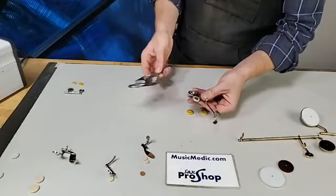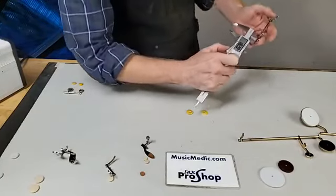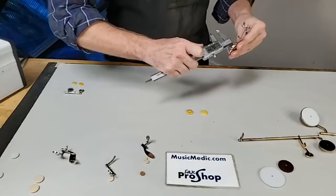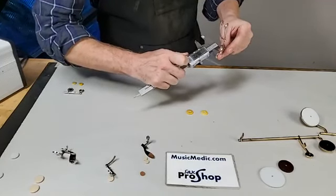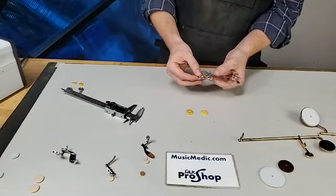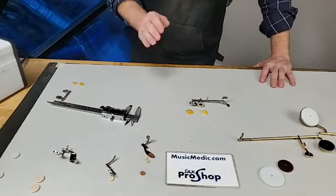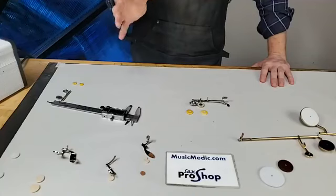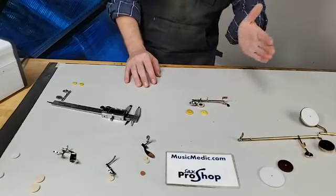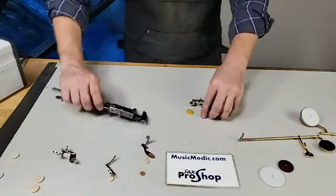Yes. All right, so again, zeroed it out. Again, we're measuring the inside diameter. I do it this way. This is saying 18.28. And this way is saying 18.20. So I probably would go with 18 on this. Okay. So if we're at point 3, we would probably round up. Might round up. It's right borderline. It might be one of those that if you're going to stock pads, maybe stock the size below, and then the size above. Okay, so let's measure our pads and see what we have here, because I can't remember.